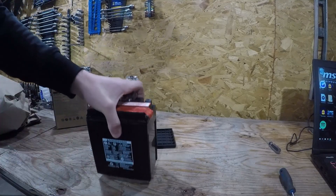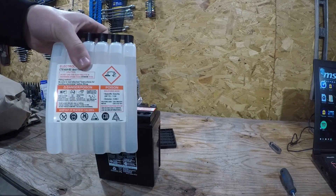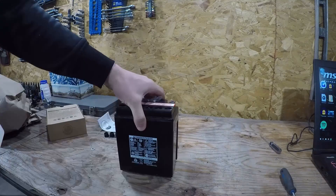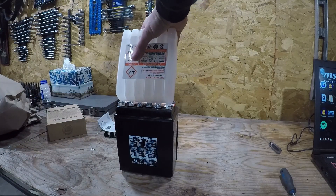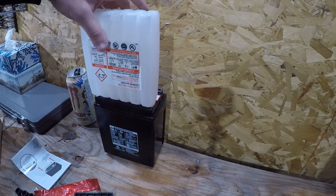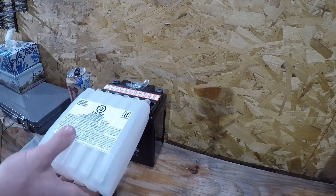If you have never filled an AGM battery before, let me show you how to do it. These batteries do vent but I'll show you what the deal is with venting on them. Peel this protective cap off the acid pack — don't throw it out because you're going to need it to seal up your battery. All those acid cells are individually packed. You should be wearing eye protection. Make sure you're lined up with the cells and then give her a whack. Just let her sit and wait for it to fill. Make sure all the electrolyte cells are completely empty — get those last little drops out.